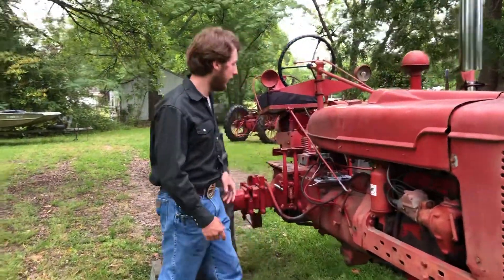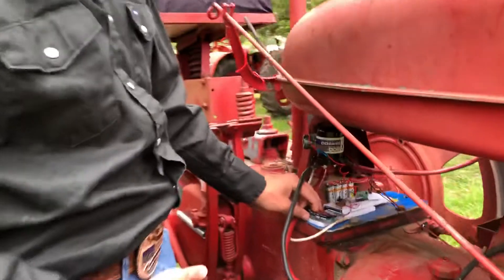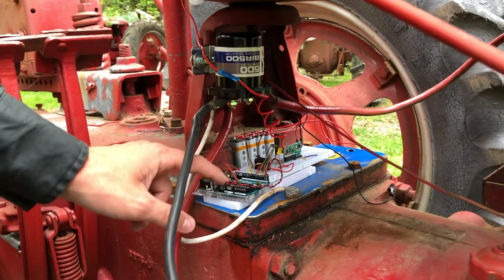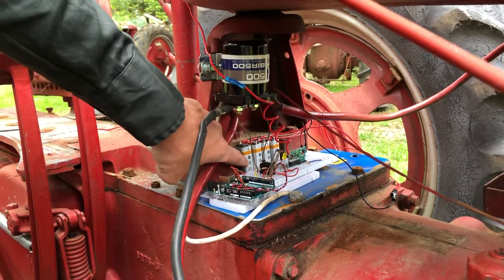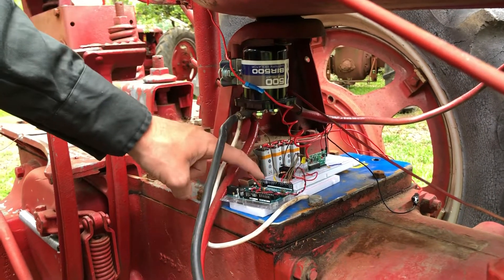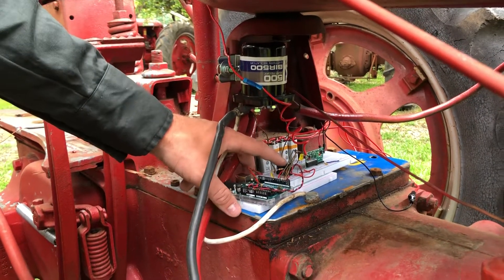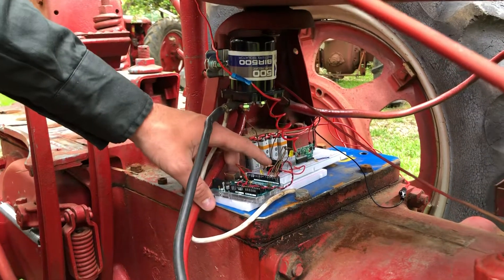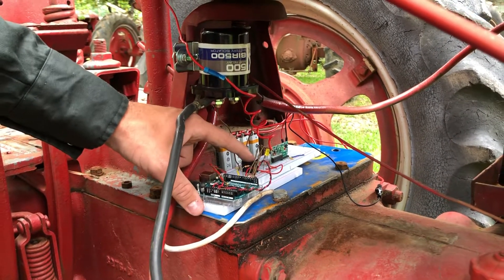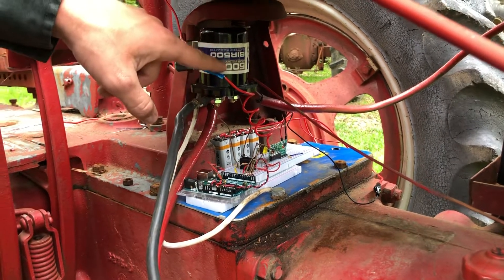As you can see it started up really well — it took a lot of trial and error to get to this point. If you'll come on up, you'll see we've got our Arduino mounted here. We've got the VIN and ground on this side, and five volts and ground run to the other side. In the back you'll notice four nine-volt batteries wired in parallel; they plug in on this bus strip and power the Arduino and the system on its own. We've got a digital pin run to a transistor relay circuit right here. When I press the button on the fob, it calls upon the digital pin to be activated, and when it does it closes this circuit on the relay — the relay has two contact wires coming out, which go to two posts on this 500-amp NVX relay.